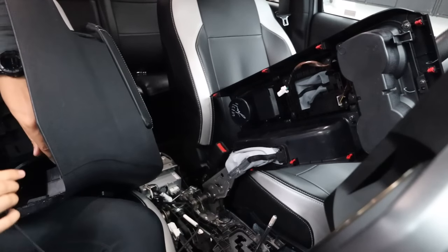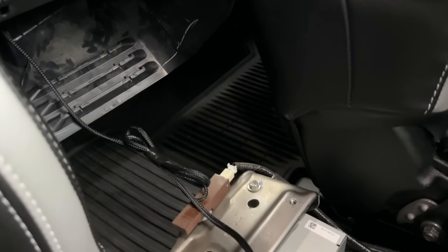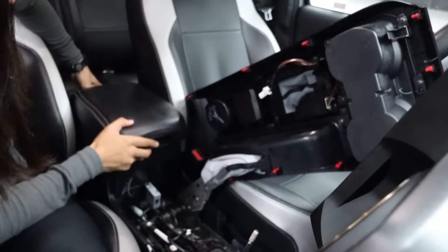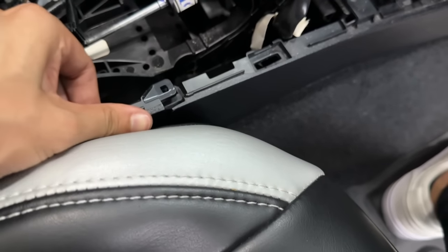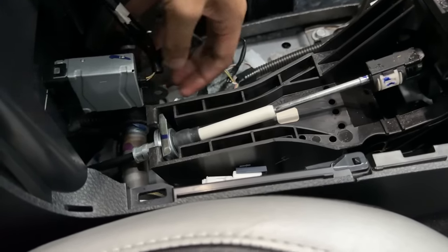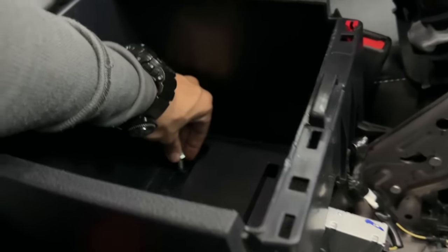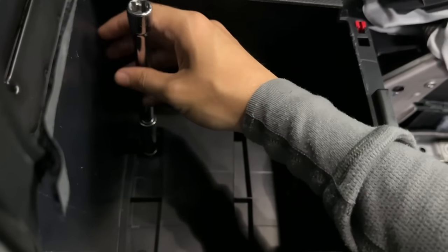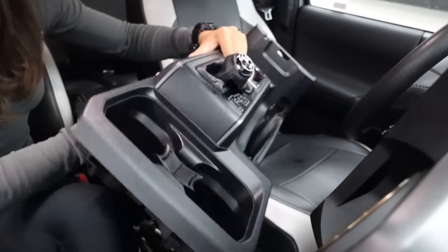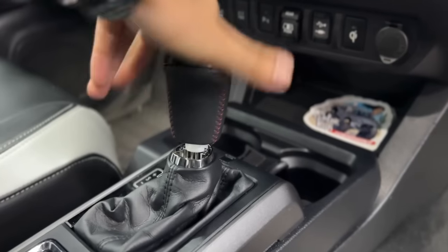Back in the Tacoma, bring the center console in and plug the harness end into the outlet — the same thing done during the test, though it's hard to show because of the coverage inside. From here it's the disassembly steps in reverse: put the center console in, line up the tabs, don't forget to reconnect that black wiring harness, tape up the wire as it was originally, add the two bolts holding the center console in place, snap the center piece back on by hand, plug in the white harness from the beginning, and reinstall the shift knob.